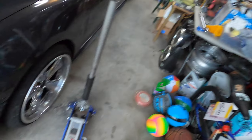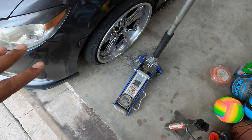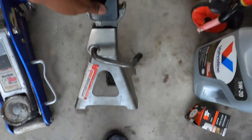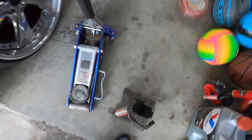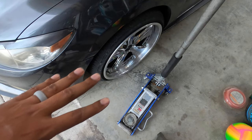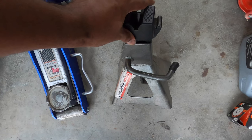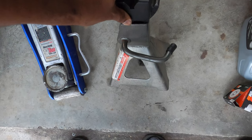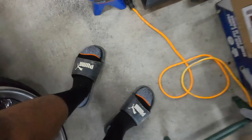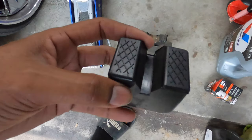If you're going to have any limbs under the car, or if the wheels are off the car and you're working on it like doing the brakes, I highly recommend getting some jack stands. It's fine to use just the jack if you're doing something quick like changing a tire, but if the car is going to be off the ground for any amount of time, please use jack stands. Order from Amazon, Harbor Freight — but not the recalled ones — or AutoZone. I do have Harbor Freight jack stands and these Duralast ones from AutoZone or Advanced Auto.